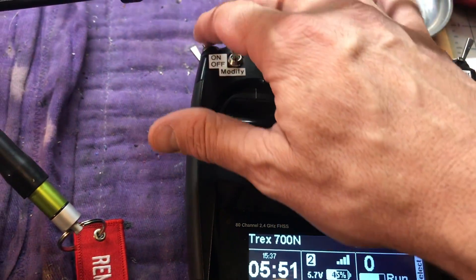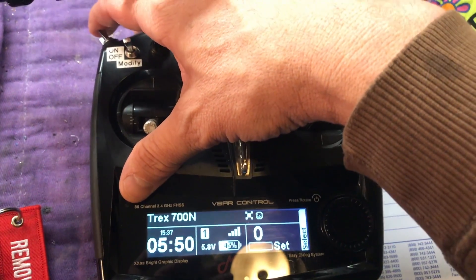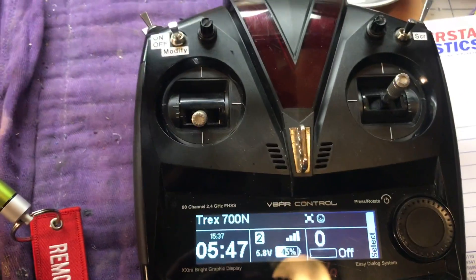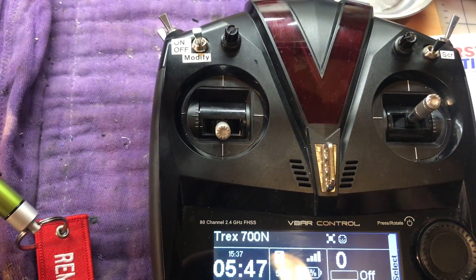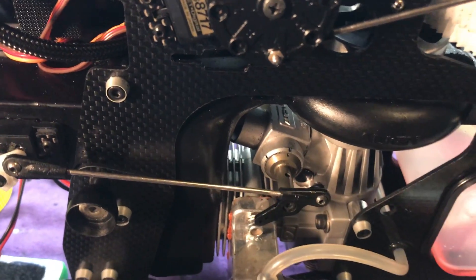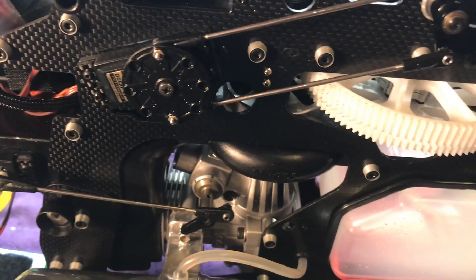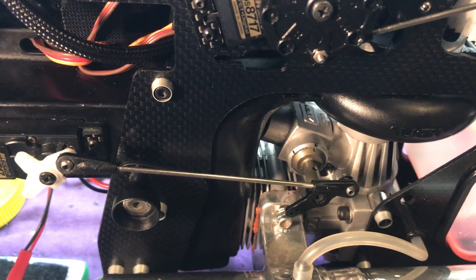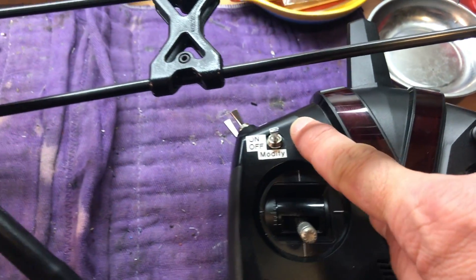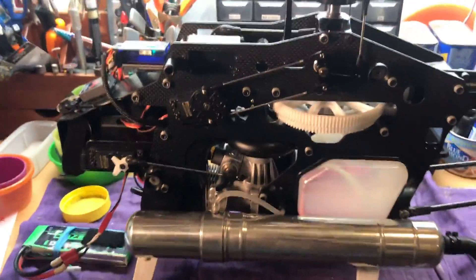The fix today eliminates the need for direct bank one altogether, so I'm going to disable that. What we're going to do instead is leave it in bank two motor off and set up a macro cells mixer so that the potentiometer knob gives you about 15% throttle advance. It will advance your throttle regardless of what flight mode you're in or whether motor off is on or off — and the genius of this mix is the knob won't give you full throttle, just a tiny controlled range.